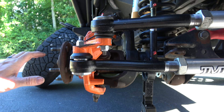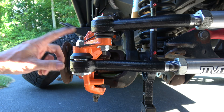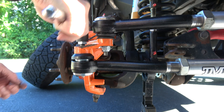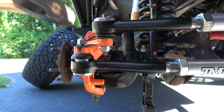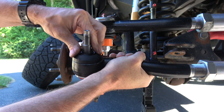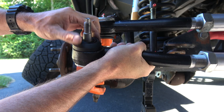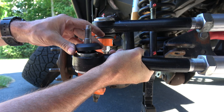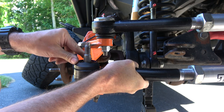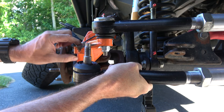Let me show you some measurements between the factory JK OEM knuckle and the Reed knuckle so we can see the difference. This seal should fit all the way down flat along the top, but once it gets misaligned it tends to want to pop out. The knuckle should be holding it from getting misaligned and popping out, but it's not. So that's why we've got to ream that.